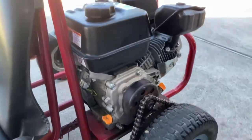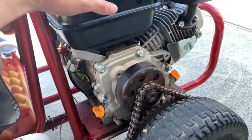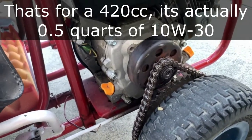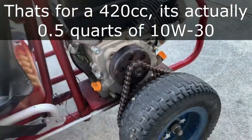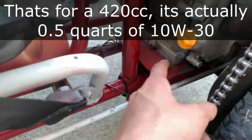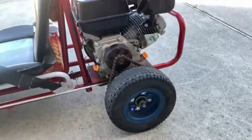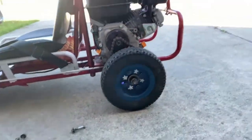Once the chain and the clutch are on, all you're going to want to do is make sure it's filled up with at least — I think it's about 1.1 quarts of oil. Then really all you need to do is screw all four bolts in, in each one of these slots. They'll come up through each one of those holes on the front right there and on the back in those two spots.